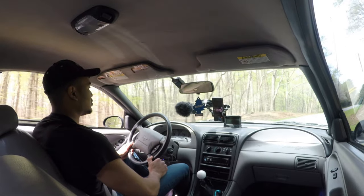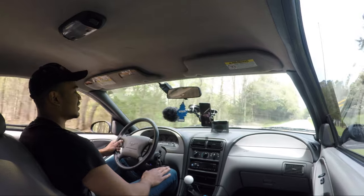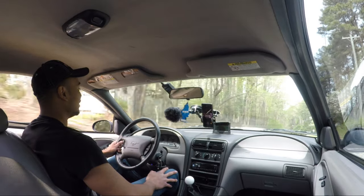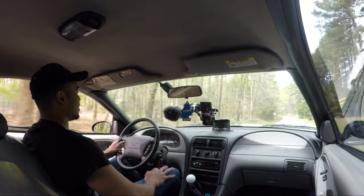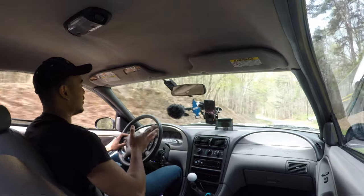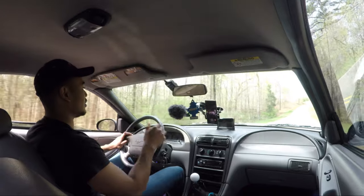With the headers, one thing you'll notice right away is you feel the exhaust a lot more — you feel it kind of under your feet. The headers aren't actually touching you, it's just a lot louder in general. The steering column cleared just fine with these headers, though I've heard some people have trouble with rubbing. On my three-valve, the headers actually rub the steering shaft on a hard turn because the engine leans into it.